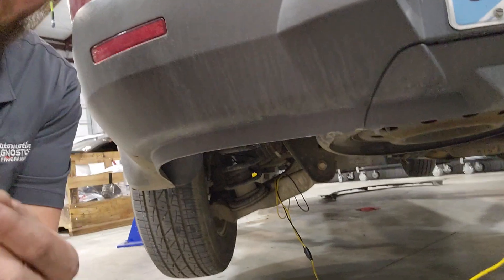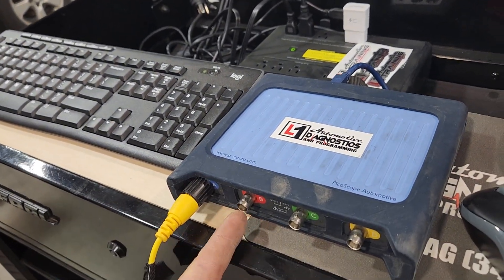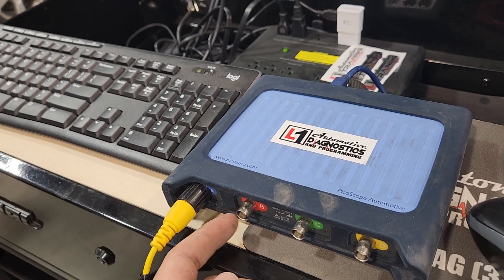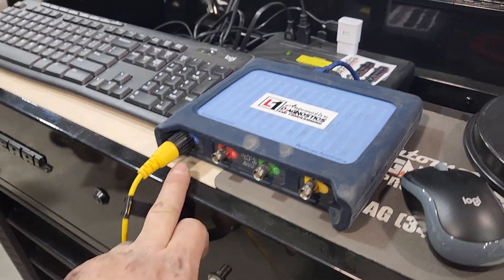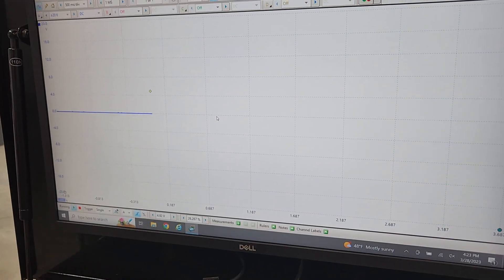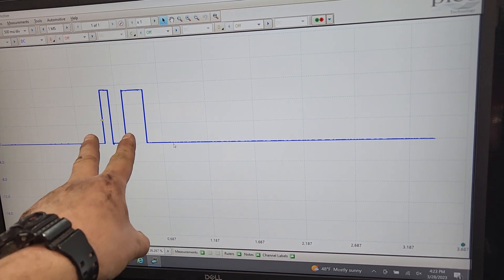So what we've done is we took the wheel speed sensor out of the car, or just unplugged it, and in place of where the wheel speed sensor plugs in, we put both wires of one channel from our oscilloscope. On your oscilloscope, you have a signal feed on the center pin and a ground on the outside — two leads coming off of one channel. We just plug those both into where the wheel speed sensor would go. Then we have John go ahead and turn the key on, and you can see we got 12 volts — twice, a quick ignition pulse.